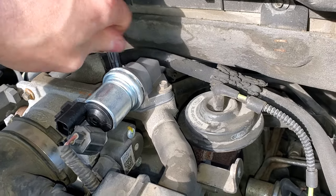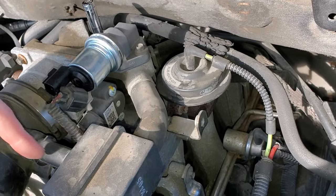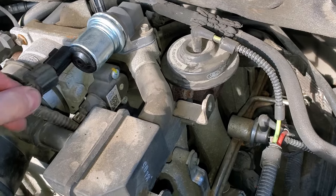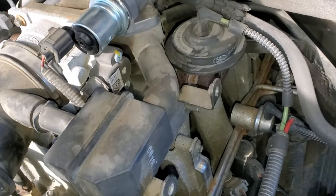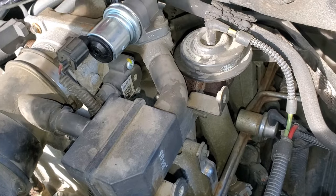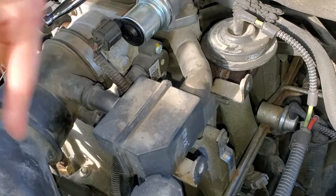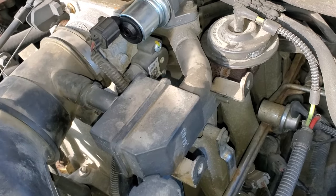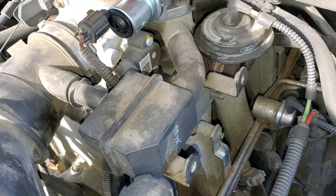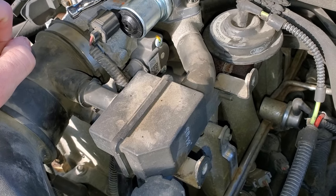While you're here you may want to inspect — there's actually a path just for the air that is metered through the idle air control valve. Fords are really common for doing that: they'll have a split off of your intake and they'll have a path just for the air for the idle air control valve. So you're going to want to look and see if there's any cracks in these hoses.